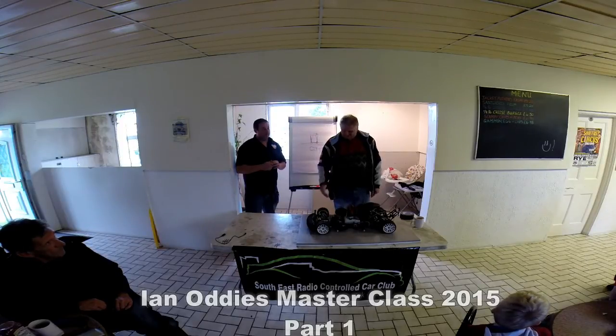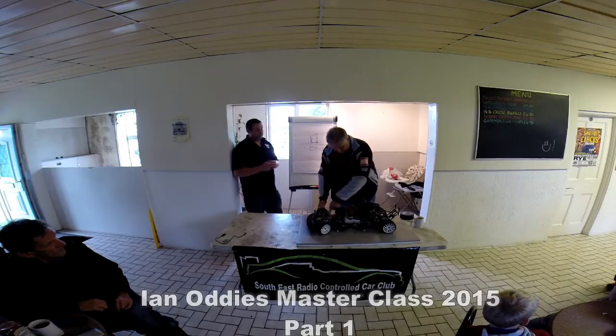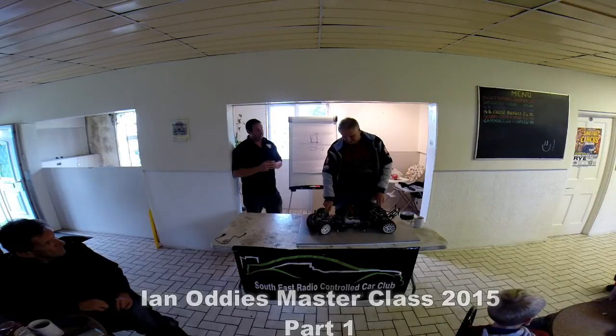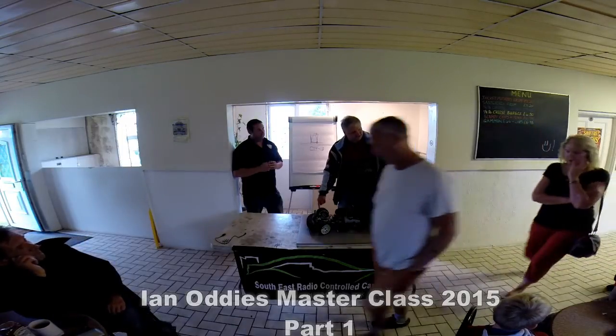That's what caster does. But it's also related to camber, because the more caster you put on, it affects your effective camber in the corner. If you put lock on and your top arm's a long way back, you're effectively pulling more camber on your front tyre as you go in, so then you can take some camber off. A lot of people end up chasing the backside in circles. They'll put more caster on and think, oh, that's not very good. But it's probably that the footprint has changed because they haven't changed the camber at the same time.